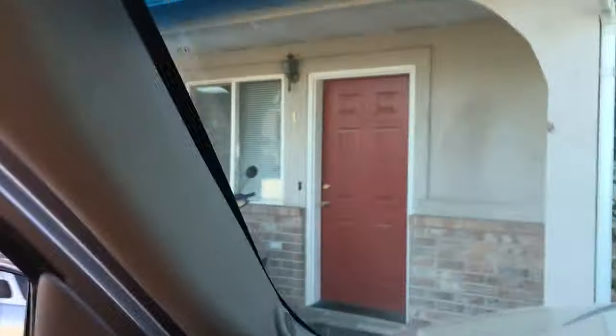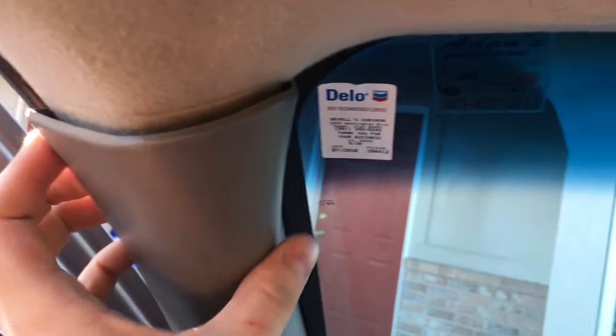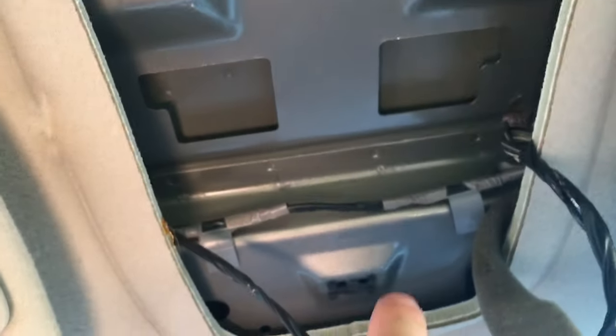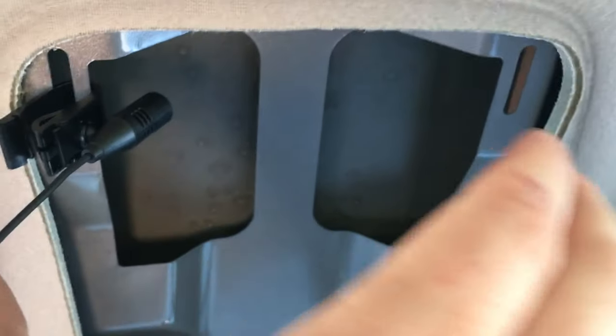If you're wondering how to get these A-pillars out, they just have these little clips. It just sits like that. You just give it a tug and they come out, and then I'm gonna run my microphone wire. I'm gonna put my microphone up here where the old OnStar mic was, and wire it up through the ceiling. To get off this center console, there are two clips in those holes right there, and then there is one screw right there. If you just look under where the lights go, there's a screw, and then you just pull on those two clips. Anyway, I'm gonna run my wire up through there,